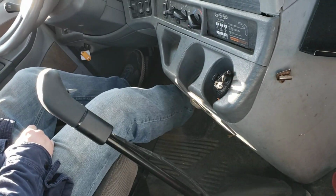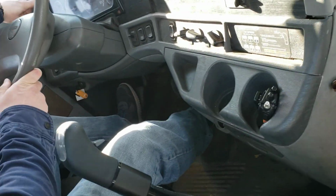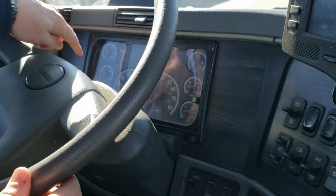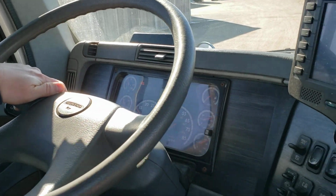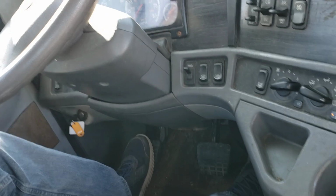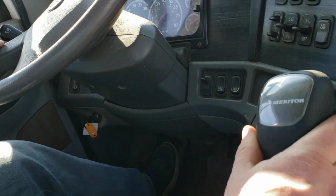So what I'm gonna do is I'm giving it gasoline. Okay, you see here, I want my RPMs up to 1400, okay? So there we go, my RPMs, 1400. Right when it gets there, I'm gonna do no gas, clutch, neutral, clutch. Ready? No gas, clutch, neutral, clutch.